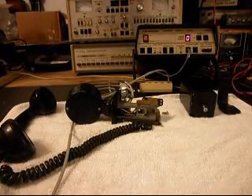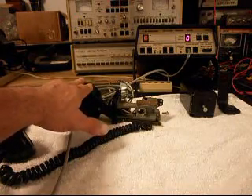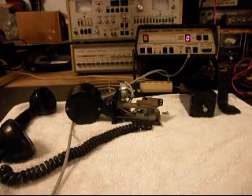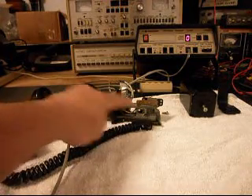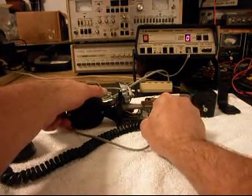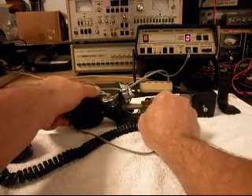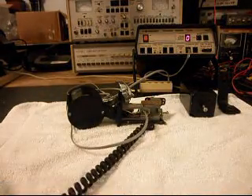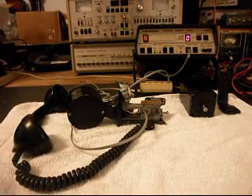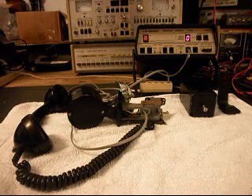Okay, we're back. Now what we have done is we went into the rotary and made sure that was taken care of — cleaned and oiled — and we also installed a screw that it was missing. Now we have installed our modular port here, and that way all Jim has to do is simply walk up to this telephone and plug it in. Makes for a clean connection, or it can be unplugged. We'll plug it in and give you some dial tone. Then we're going to go ahead and put this telephone back together again and we'll do some final checks. We'll be right back.